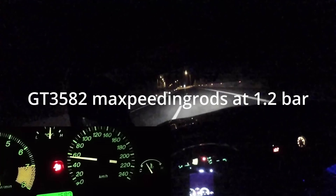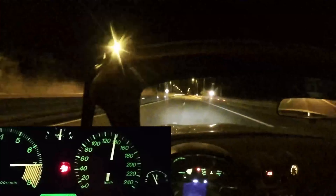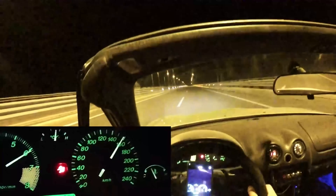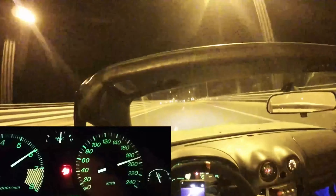A lot of them tend to perform really well and work for quite a long period of time, even at higher boost levels. I've heard from multiple people in various Facebook groups, especially in 180 groups, where the turbochargers are quite small and still run under relatively high boost pressures up to like 1.5 bar, that these turbos last pretty well. I had that same experience with my Passat — I ran that K03 at about 1.1 bar, which is like 16 PSI, for about 15,000 miles, and it was fine, even though EGTs were very high, probably around 900 to 950 degrees.